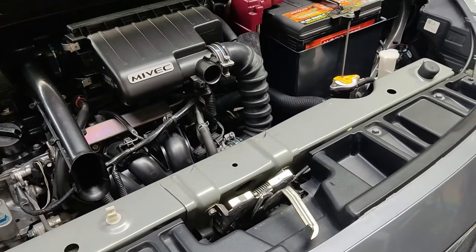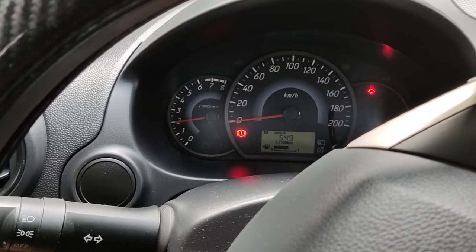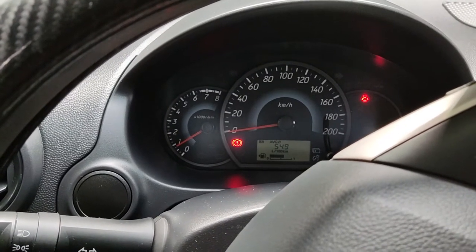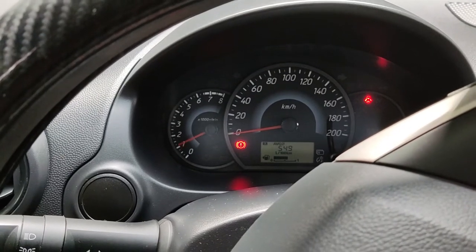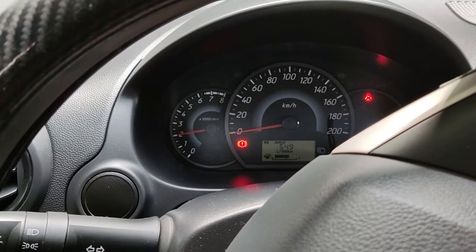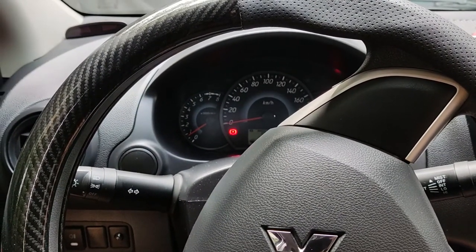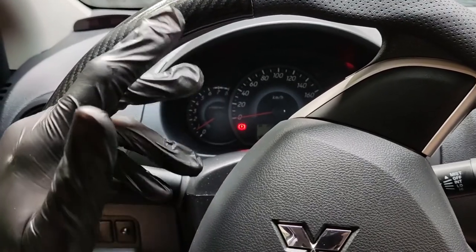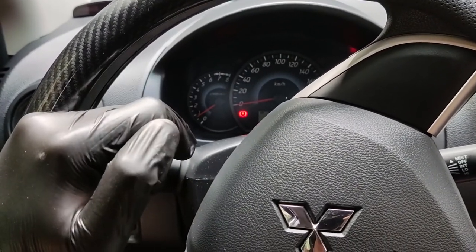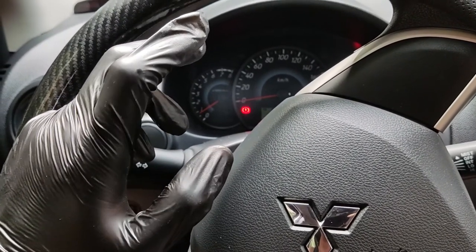We are done. Let the engine run for at least 10 to 15 minutes to circulate the coolant through the cooling system, and clean up any spilled liquid or coolant from the engine bay. In the next few days, check from time to time if the coolant level is dropping. If it drops a little, just top up at the coolant reservoir. If it drops a lot, you might need to check for leaks. That's it for this video — hopefully this was helpful. DIY saves you money and teaches you skills. Even without being a mechanic, you can handle basic car maintenance. Please like, comment, and subscribe. This is Raven from The Raven Vlogs — thank you for watching, adios!